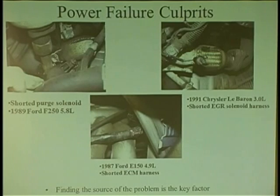Hopefully, if you want, put a fuse in and the car works, send the customer off and say, look, I'm not going to charge you anything, so you're not liable, and let's see what happens over the next couple days. It may blow, it may not blow. But intermittent shorts are a hard thing. So you at least want to take time out, and maybe look at the diagram and go, all right, well, it feeds the oxygen sensor, and it feeds the idle speed motor. That just feeds a bunch of components.